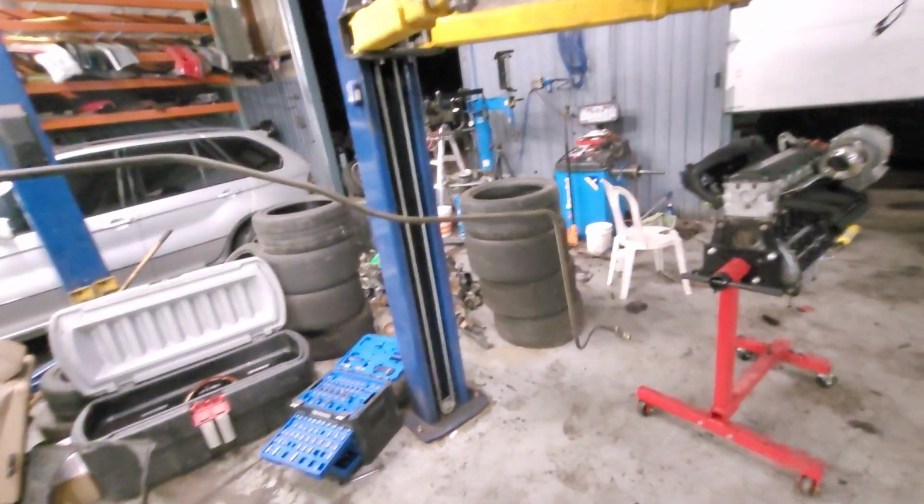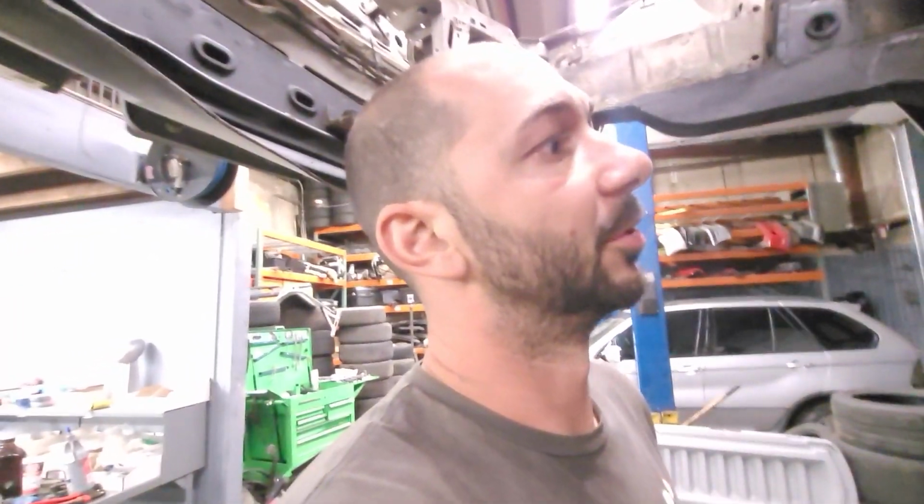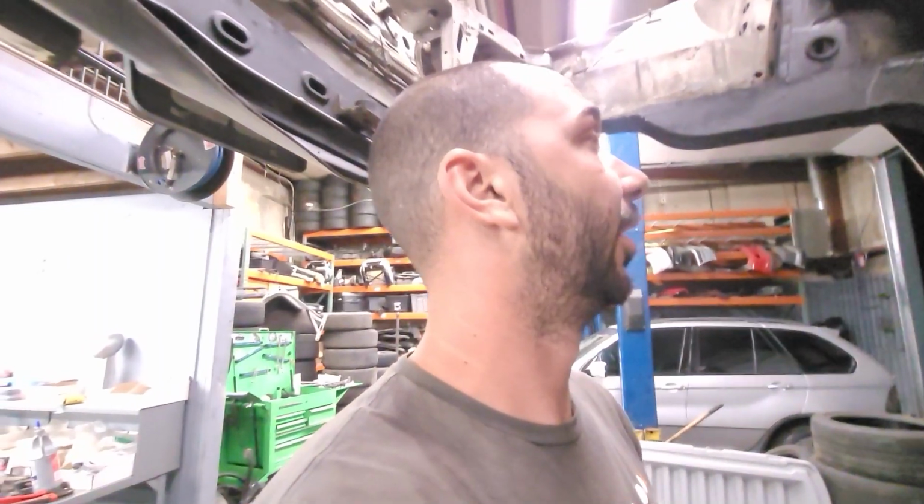So in the last video we pulled these brake lines out of that blue convertible. I think that was the last video. I know there's been a lot of videos lately. So we can run those and put the new master in to each side, and then we're gonna need a little bit of work in terms of the flaring. I talked to Hamish about it, and he said Aaron might not have the right flare tool for the BMW, which I think is an inverted flare or a double flare. I don't remember exactly what we have and what he can't do, but we'll get that all figured out.